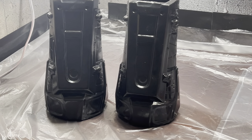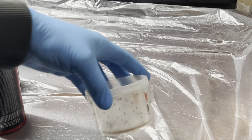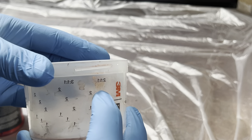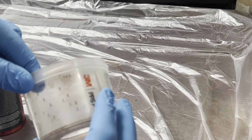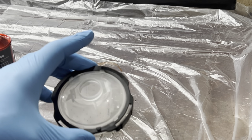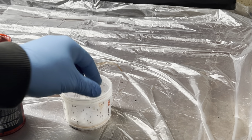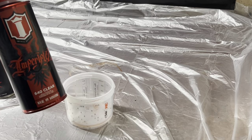I'm going to get these parts cleaned up — wipe them down with acetone and let that flash off to make sure they're good and ready. The 3M PPS cups are marked — the liner cup you never throw away, always keep that. Your liner and cap are what are disposable. Now we're going to mix up our two-to-one-to-one mix of the Imperial Flex.